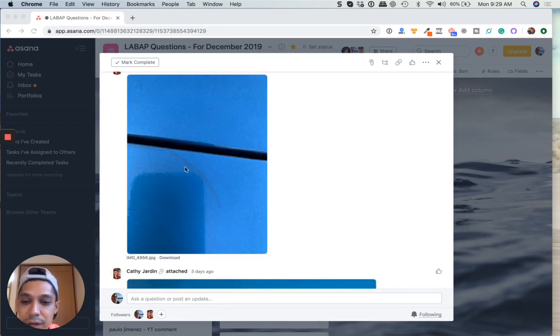This looks like a very cheap clear was used, and when it was cured, it basically cracked open. Or it could be from, like I said, somebody masking this line underneath and then taking the paper or the masking tape off, and then it kind of gouged into the clear. But this clearly looks like a crack to me. It looks like it cracked up. So this is the result of cheap clear coats. This is what's going to happen if it's too thin and it's a very cheap clear coat.